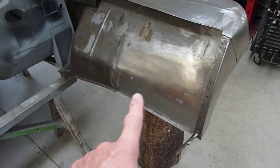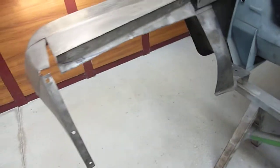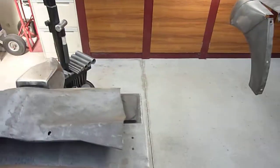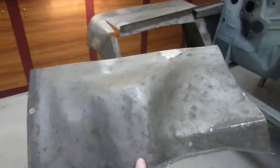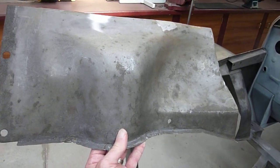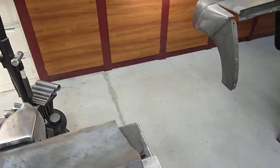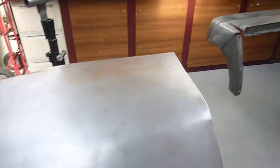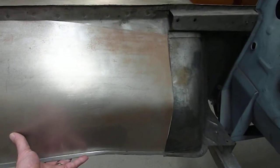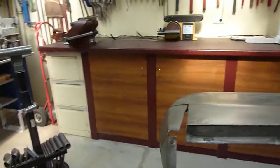You can probably see here I've removed the pressing from where the clearance was for the shock on the inner guard. This one is still in the process from a year ago of being modified. What was in here before — what's under my hand — is the clearance for the shock absorber mount on the chassis, and that big dip in there was for the oil bath cleaner. So I've made up this new fender here which will slot in there and take up the extra length I need.